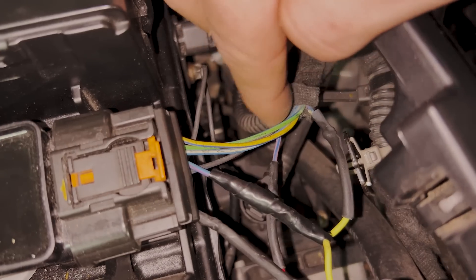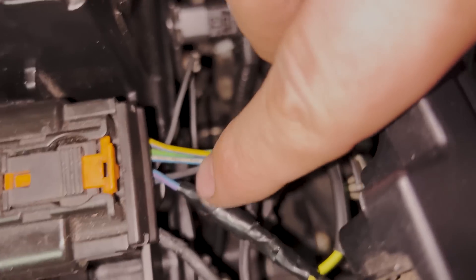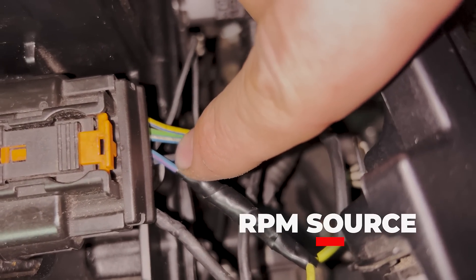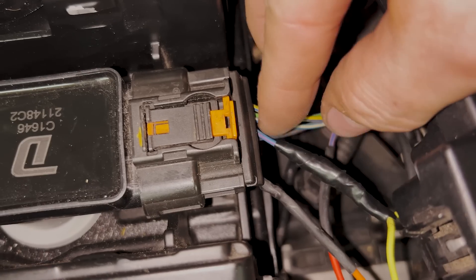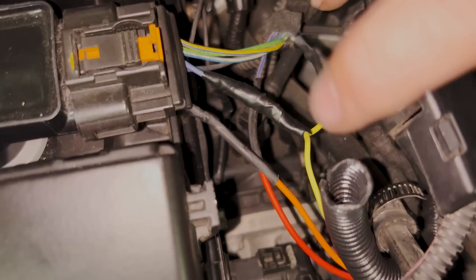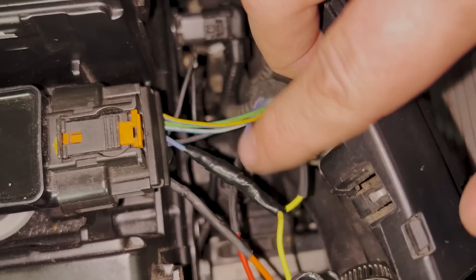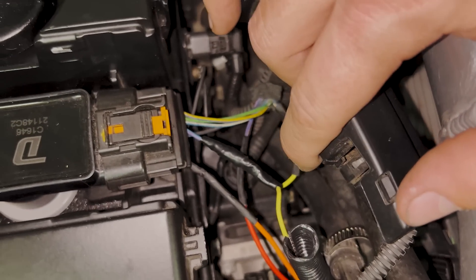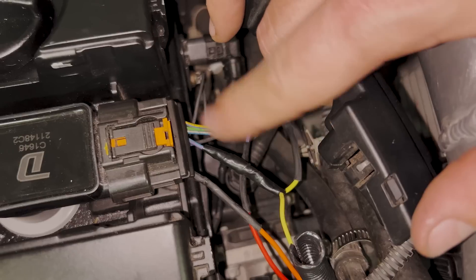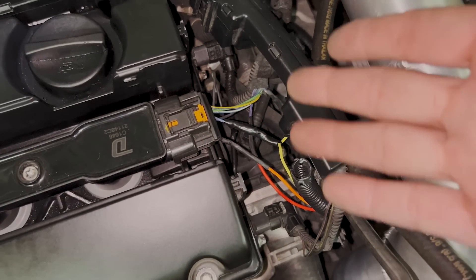This is the ignition source going to the part of the coil pack that controls coil number one — in this brick of a coil it is the blue with the violet stripe. The only reason you're seeing some extra yellow wire here is because I gave myself a little extra room to work with in such a tight space, so I just extended it using some extra yellow wire I had cut off earlier. It is going to be a bit of a pain to clean up and make look nice, however the car started and works just fine.